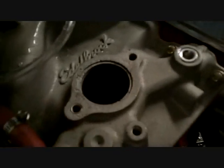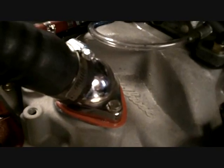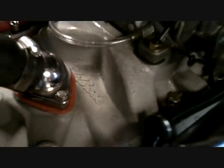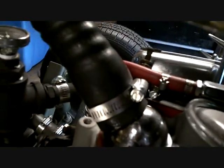All right. Okay. The new gasket is in. I didn't have that size O-ring, so I ran and I bought one. I got silicone on it, top and bottom. I've been letting it cure. I put a little grease inside the hose before I put it on. That one's okay. No, it actually didn't leak. This one did.